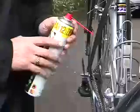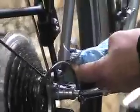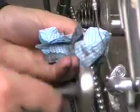Whichever lube you choose to apply, dry your chain thoroughly after rinsing it. Lube sparingly — don't go mad. It's critical to wipe off excess lube with a cloth. Your chain should feel dry to the touch, with just a hint of lube, no more than a light film on the chain plates.